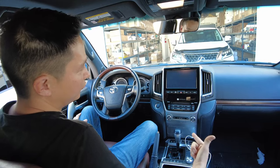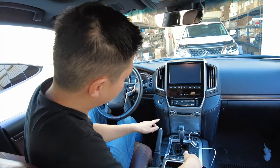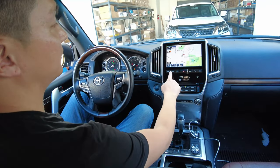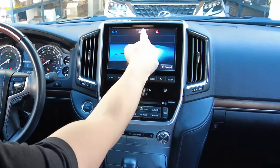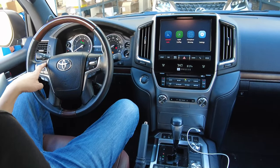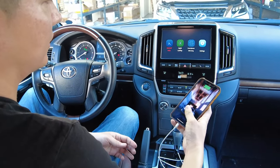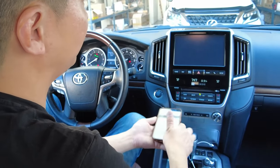We just finished installing our new wireless CarPlay Android Auto system to this Toyota Land Cruiser. Now let me show you how it works. Go ahead and first turn on the car. Everything about the infotainment system is going to be exactly the same as how it was originally — there's not going to be any change. The only difference is CarPlay is now installed. To access the CarPlay menu, first make sure you're in auxiliary mode so you can hear sound through the CarPlay system. Once you've selected that, just long press the up arrow button and it'll take you to the screen. You can also use this as a traditional wired system if you wish — just connect your phone to it and it loads automatically.